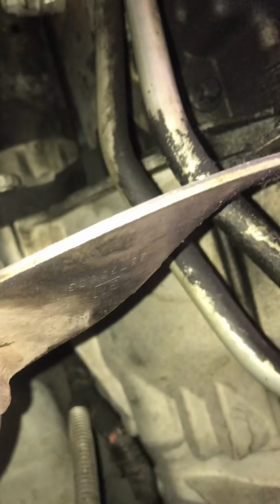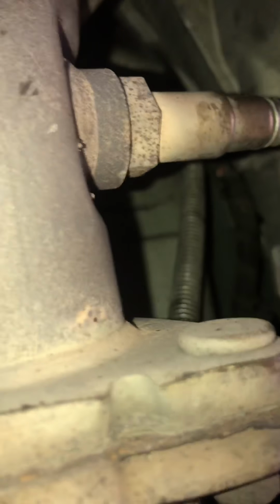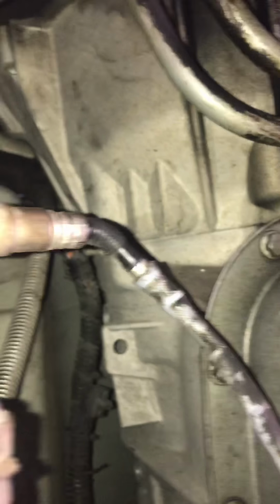All right, so yeah, I'm tripping. You can't get this off to move out of your way until you unbolt these ones too. So basically, this whole assembly right here has to come down and off. I just thought I could lay it down, but now it needs to come out. So I'm going to take my O2 sensor off and let that hang somewhere. I'm going to get these bolts off, and we should be good. Now, these ones looked hard on there. Let me do that, and I'll be right back.